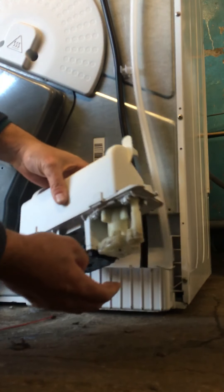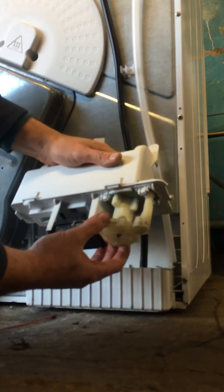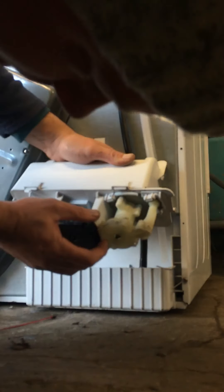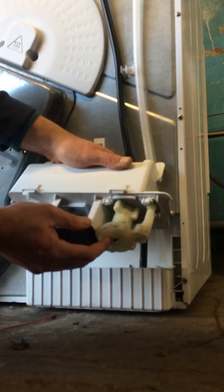Now this is pretty clean. Sometimes if the pump isn't pumping water up, just check under here — you might be able to see. There's a little propeller. I can see it here. It gets dislodged sometimes; make sure that's on properly.